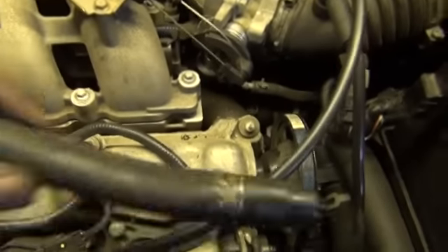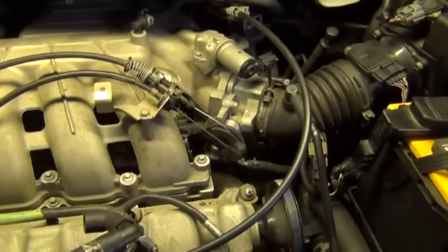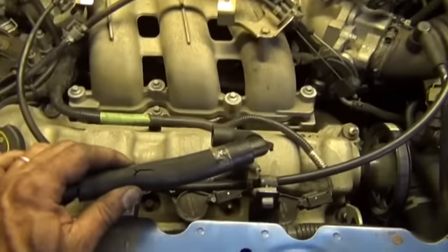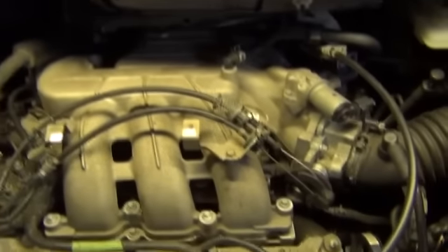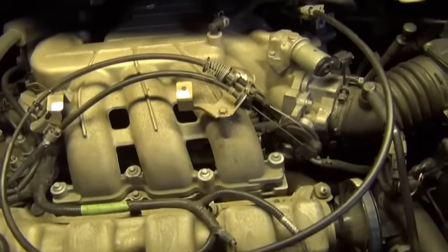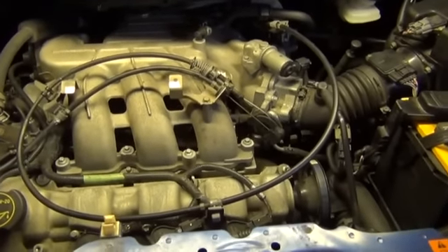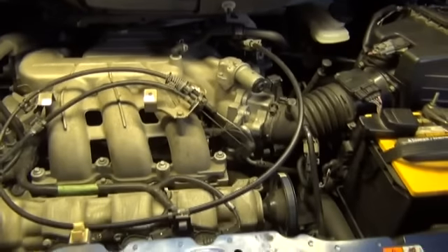I didn't like the way that engine vacuum was sucking this hose down completely flat — it made me think of that bad PCV valve. On BMWs you can have oil consumption from a bad PCV valve, and you can also have engine oil get sucked right up into the engine causing a hydro-lock. I'm not sure if that ever happens on a Mazda, but it'd be preventative — I wanted to make sure I replaced that valve. Once the intake plenum was off I was able to pop those locks off using a mirror, and then it unscrewed counterclockwise while the new one locked in clockwise. Thanks to YouTube for someone posting a video with those faults — at least it led me to this cracked hose and a fun evening taking apart my wife's Mazda.